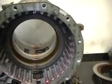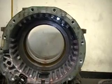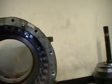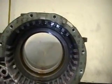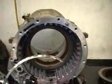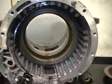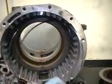Now we have the B4 clutches to inspect. This has a double snap ring. On the C3 clutches, the opening was positioned at the one o'clock position on the side where the turbine speed sensor is. This one is also at one o'clock but on the opposite side — that doesn't mean anything, it could go either way, but just remember it is towards the top of the clock. To separate them, remove the double snap ring and then the next one is just a spiral snap ring that you remove.